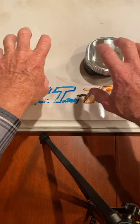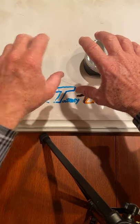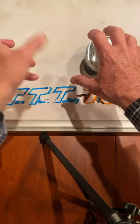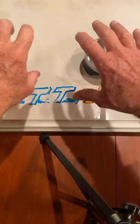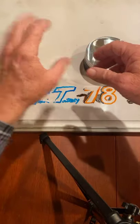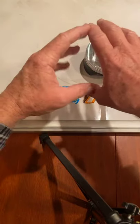The stock size on the crank and the stock size on the clutch basket is very important because it gives you a 1.36 ratio, which puts a lot of power into this clutch, which was designed to handle it. If you take teeth off of the front sprocket, you're increasing tons of load into this clutch. Your clutch wasn't slipping that bad. Now it's slipping really bad as soon as you go down teeth on the front.